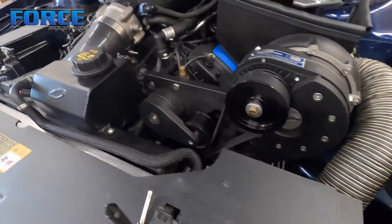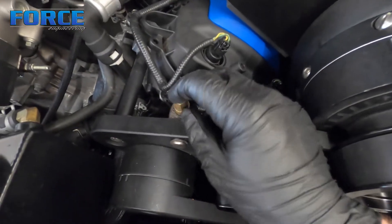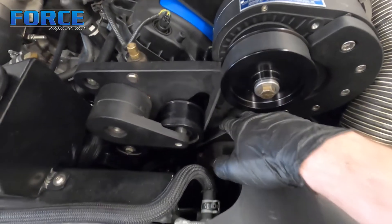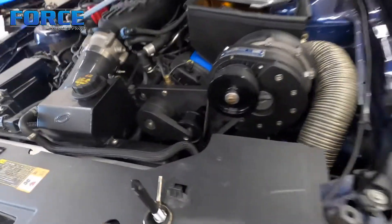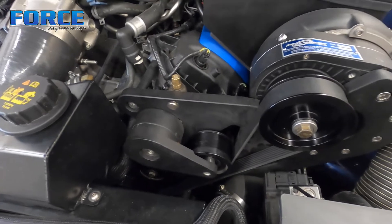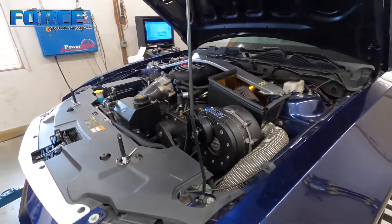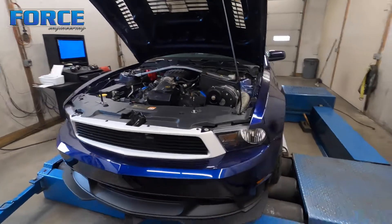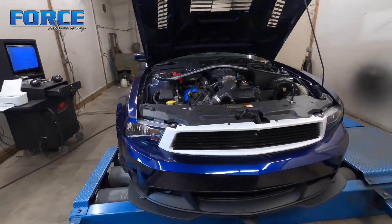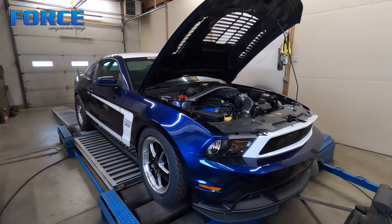She's on there. Unfortunately, ProCharger actually sent us the wrong belt — the one they sent was too long, so the tensioner is pretty much maxed out on adjustment. The belt is fairly tight and will be okay for now, but you want to keep that tensioner with some adjustment room; we pretty much don't have that anymore — maybe another half inch of travel. Anyway, we're good to go. I'm going to pull a couple degrees of timing out at the higher load levels we haven't been into yet in the timing map.